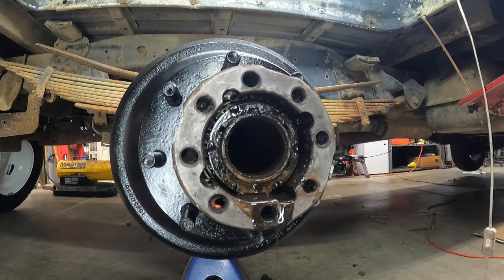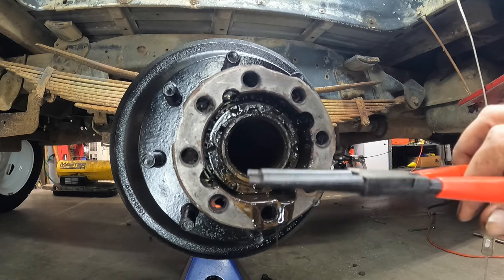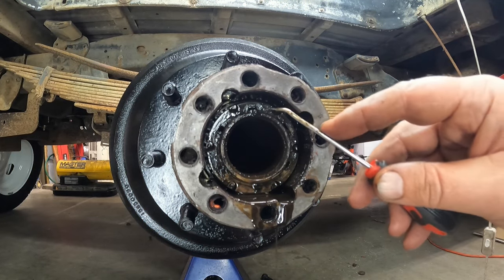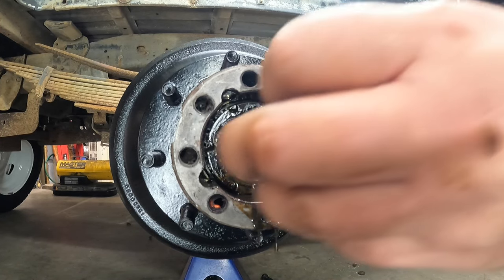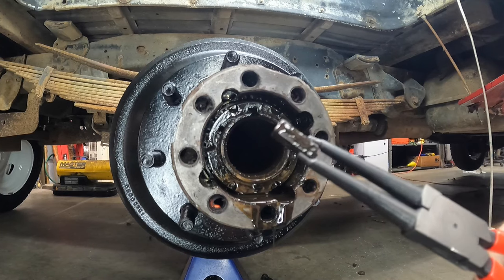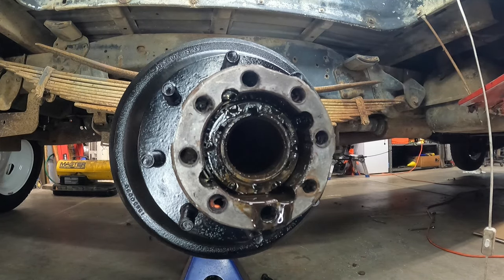I tried tearing down the other side on camera but there's just not enough room. You could probably use needle nose pliers to grab that little fella - it just slides right out. I was having a hard time getting a grip so I've got these little ring pliers with a finer tip to actually get in there and grab it. If you had a fairly strong small magnet you might be able to get it out too. I'll just pull it out with the pick. This little guy just gets held in place in a channel in the axle tube, and there's a spot in the nut for this guy to slide into - that little lock washer just keeps it all in place.